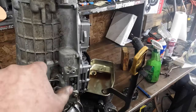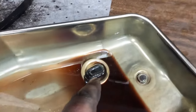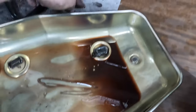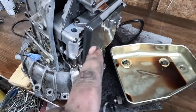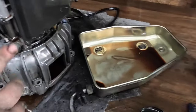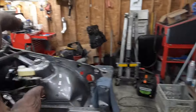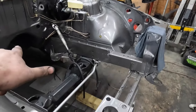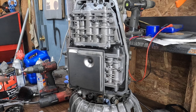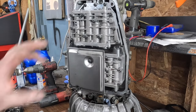This is one of the few things that actually worked on the car when I first got it. I think I'm just going to pull the pan off and make sure there's no big chunks down there, put a new filter in it, and slap it back in. As far as the fluid goes, it's not great, could be worse — a little bit of clutch material on the two magnets, but it doesn't really seem to be much worse off than just quite overdue for a service. I'm going to put it back together, but I forgot to get a filter and pan gasket. I'll put it back together now and later I'll pretty up that pan, but I'll give it the industry standard brake clean shower to loosen up any persistent clutch material. I'll wait till next time to paint the pan so I don't scuff up my brand new paint on the transmission jack — obviously the prettiness under here is paramount to success.